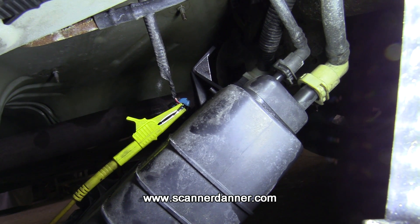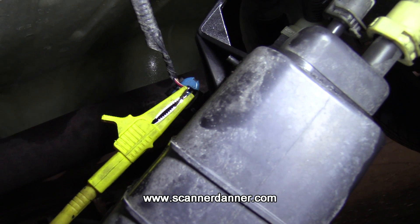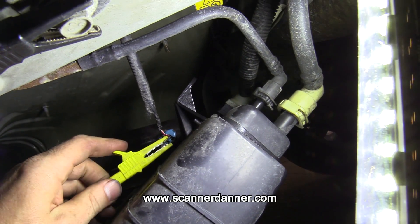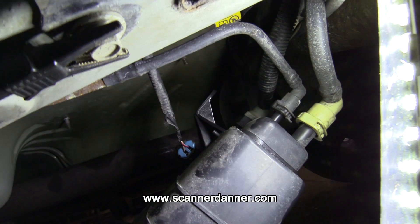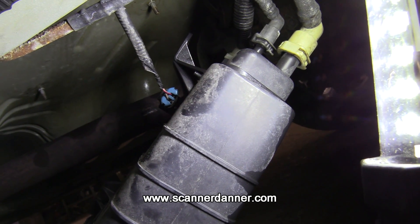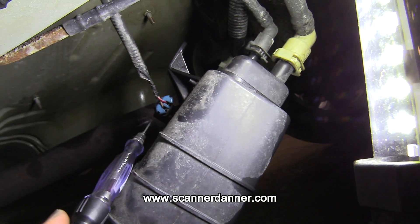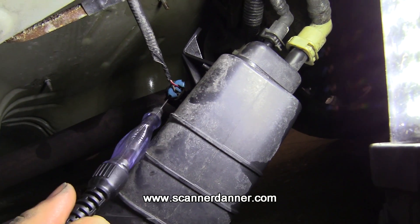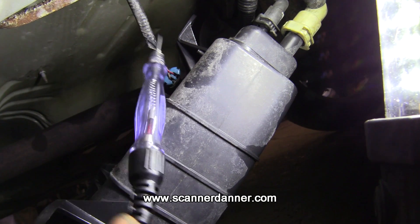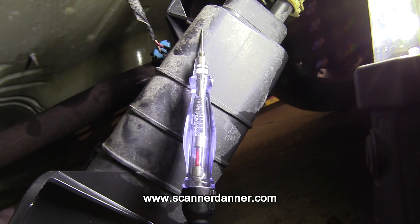Great lesson on why we need a test light. I just had a big argument with some people on Facebook about when to use a test light, and this is when you use it — manufacturer flowchart even recommended it. In some of those guys' defense, if you're not careful with test lights you can hurt things on modern vehicles, so don't be plugging your test light in just wherever you want. Outputs — solenoids, relays, injectors, electric motors, light bulb circuits — that's where this tool comes in. When you get into module-to-module communication, you better be careful, especially on today's cars.